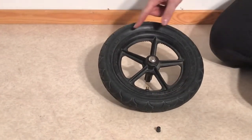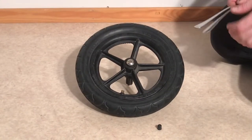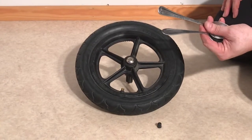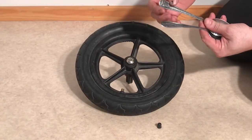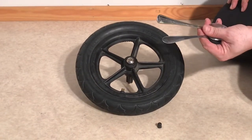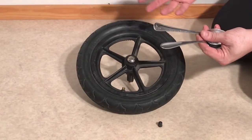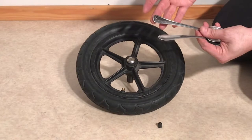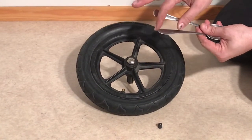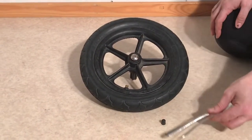You're going to need a pair of tools in order to pull the tire away from the rim. One thing that people tend to have around the house that's handy is a pair of spoons — ones that are rounded and do not have sharp edges. They also have specific tools for removing tires from rims. You can use really anything that is long, flat, and preferably metal, although plastic works as well, as long as it's rounded — so that you don't wind up puncturing the inner tube while using your tools.